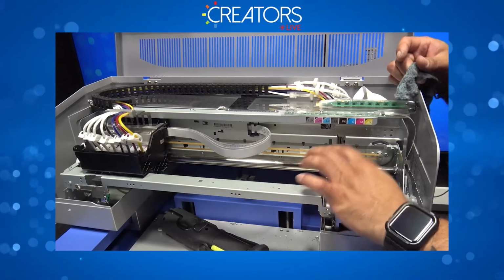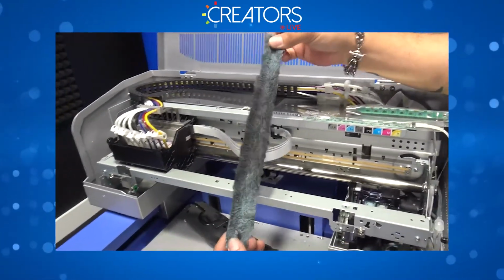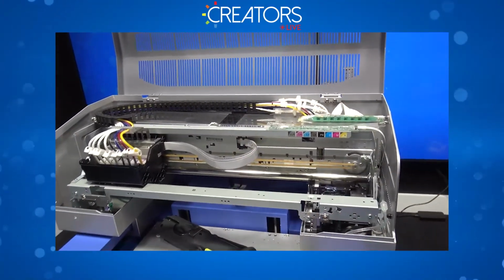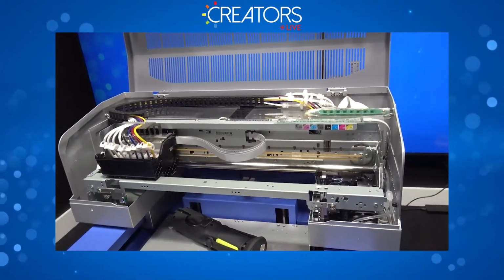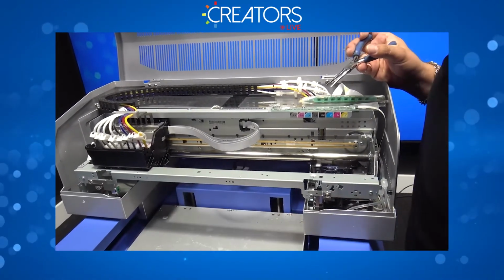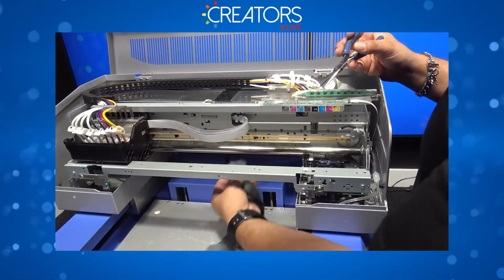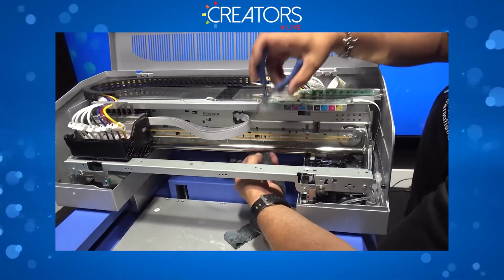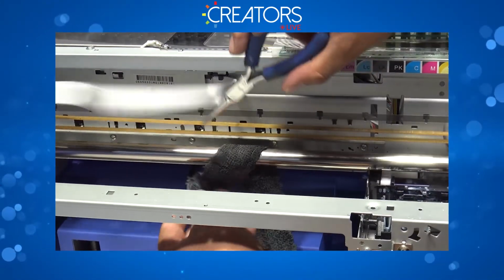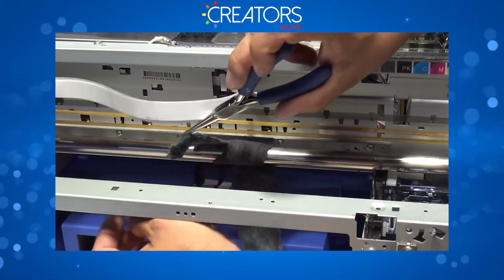it's cleaning this shaft. For this shaft, as you can see, I've been using my piece of cloth too much, so it's kind of dirty. It's not going to affect anything, it's just going to be wiping old grease. So this is what you want to do. You want to cut a piece of microfiber. You're going to stick it from the bottom to top. You can use some needle nose pliers to pull it. Then do another wrap. There you go.